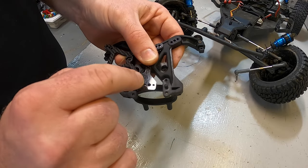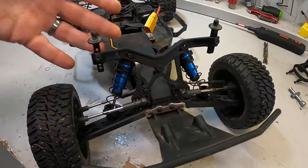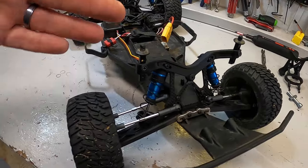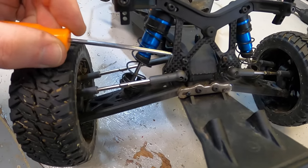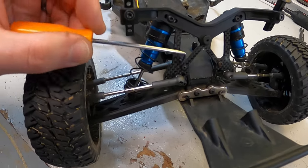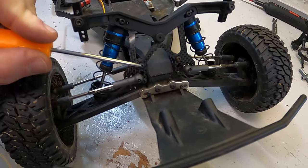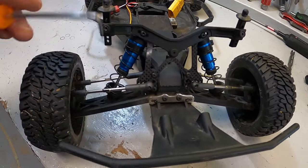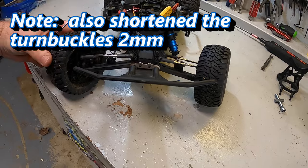It just has a hole on this side so we will be leaving that open. Look at that — the carbon fiber up there looks so good. It should also have taken off weight when you consider this is all we're removing to make this swap. There are three holes on either side to mount the tie rod links, and I did end up having to drill out and use the inside hole. It's not meant to have a nut on the inside, so I ended up having to open up that housing just a little bit to create clearance for that nut to go in there. Now we have the proper front alignment — steering and everything is still great.